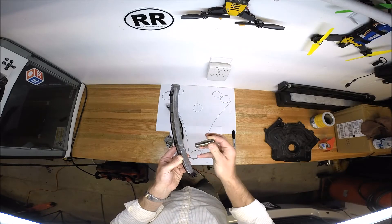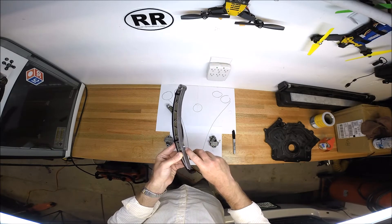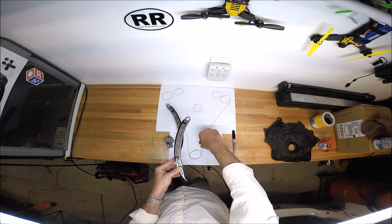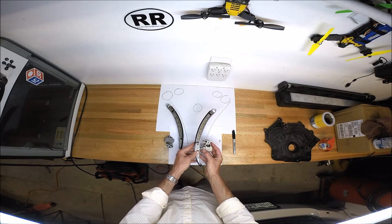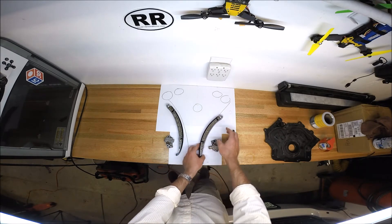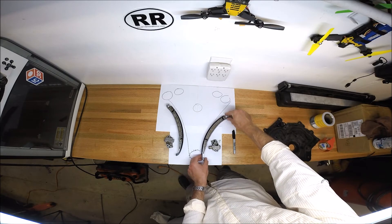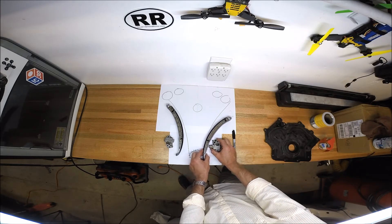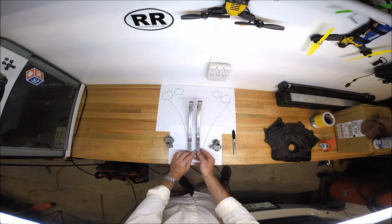So this is what causes the problem. This interface wears, and we believe this extra two millimeters or so of wear has pushed the system beyond its tolerance. We think the noise — the rattle, ticking, clicking — is the tensioner piston hitting the timing chain guide. At idle, around 800 rpm, there's some bounce in the guide, and we think it's leaving contact with the piston and then coming back and slapping it. This wear is what happens with the stock timing chain guides.